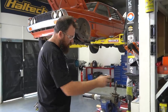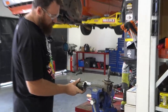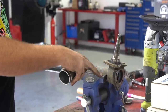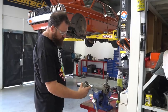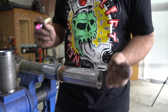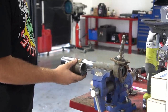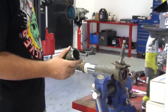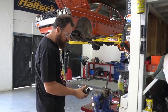I've worked out where we're going to mount our coilover collar, which is about 160mm from the bottom of the leg to the bottom of the coilover sleeve. Unfortunately what I've just worked out is the lower spindle mount top face is not parallel. So I started measuring it up and basically this cut line was not going to be square to the strut body. So what I've done is just measure from the top down 160mm — that gives us our cut line, basically half way in the middle of the sleeve. Any shortening we do is going to end up inside this sleeve, which is also going to act as a strengthener because we've modified these sleeves so that we can weld the top and the bottom to the strut body now, giving it heaps more strength.